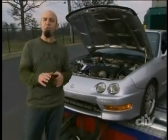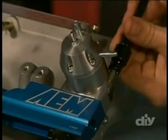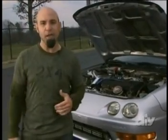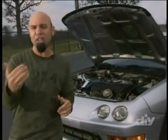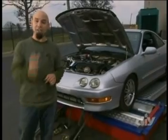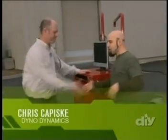I upgraded the intake manifold for a less restrictive one, ported out the throttle body to match, and while it was out I upgraded the fuel rail and added an adjustable fuel pressure regulator. In theory, the new mods should work with the old mods to move more air and fuel through the engine so when the car owner Rick steps on the gas, he's glued to the seat. The only way to know that your pain equals real gain is to put it on a dynamometer, do before and after runs, and compare the charts. Chris from Dyno Dynamics is here with his portable dyno to test our project car — before the mods we ran 154.8 baseline horsepower.